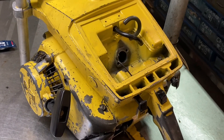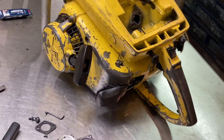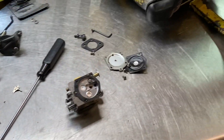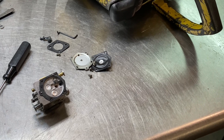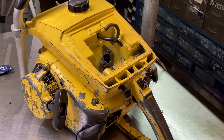I'm assuming that's what it was, don't know for sure. Anyway, I'm going to put an inlet needle in it and we'll fire this thing up. It was leaking — I did a pressure vacuum test with the gauge and I was getting some seepage. We were getting hydro lock in the cylinder, and we'll correct that and get this Super Pro running.